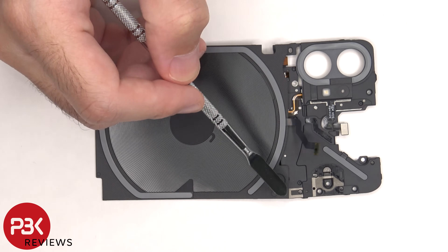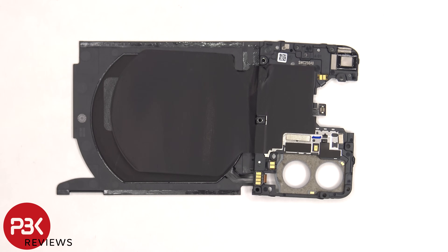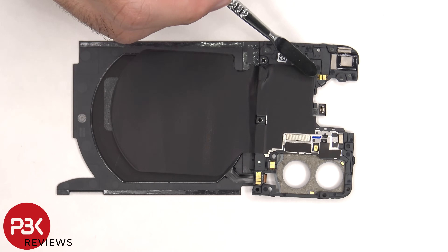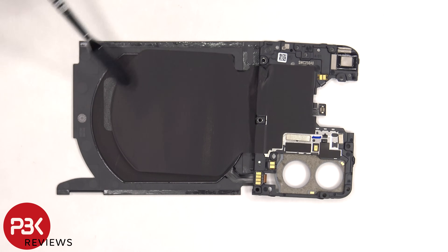There are some antenna lines — these light gray colored lines on the plastic piece — and the LED flash is located here. The flex cable for the wireless charging coil is located here, the cable for the light-up LEDs around the camera is located here, and the one for the light-up strip is located here. All of those cables are adhered to the back of the plastic cover. There's also a secondary microphone located here, and there's graphite film to help transfer heat.